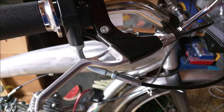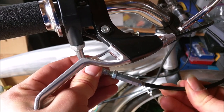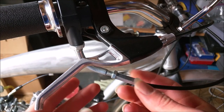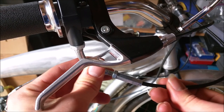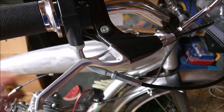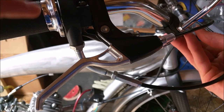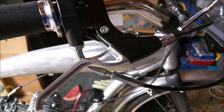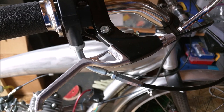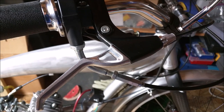Starting with the bike itself, the first thing I noticed was the throttle assembly. The throttle has a lot of give in it — this is as far out as I can adjust, both down here and at the carburetor. You can see the throttle handle just turning as I push it in and out, meaning it's not very tight. It also moves back and forth. I oiled it so it runs smooth, but it's really poor quality. I've seen videos about upgrading to a motorcycle throttle grip, which is what I might end up doing.